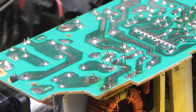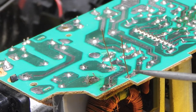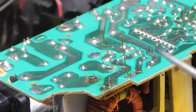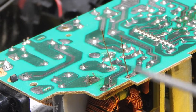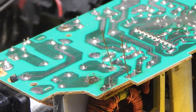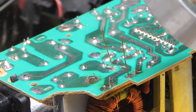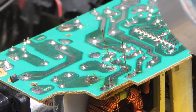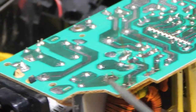Well, getting those wires in there was pretty tricky, to say the least. I left the two new repair wires extra long so I could feed those through first, and then I didn't really have to worry about keeping those guided into position as I worked on getting the two forwardmost wires in there. They're so thin that I actually have to look at them under magnification just to make sure they're even there. And they are. And then there's only 3 pins that hold the board in position.